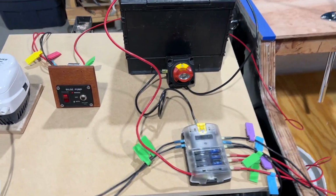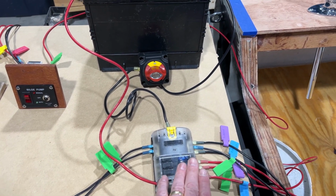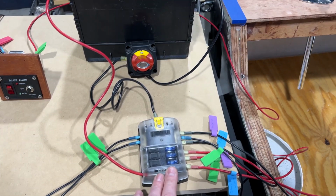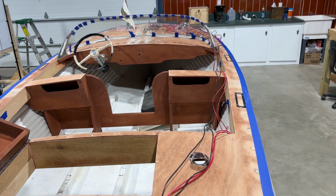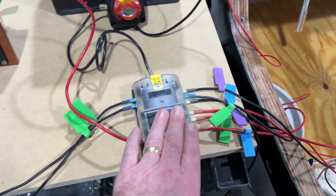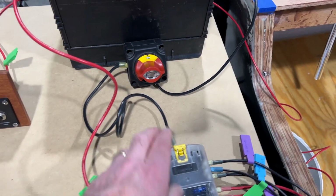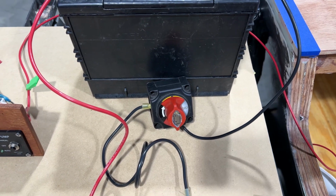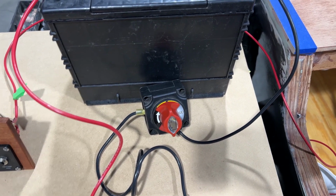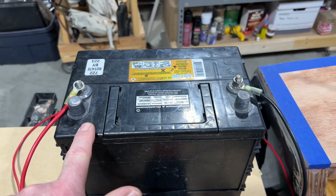completed the rear electrical system area connections. We have the fuse bus, or block, some people call it, that run to the lines on the front, and then they return as grounds, completing the loop, which then is connected to the battery switch, which allows me to turn my system on and off, everything, and then which leads to the battery, which is the source.